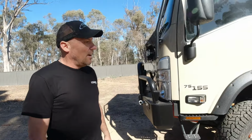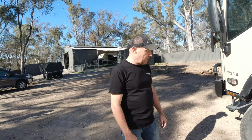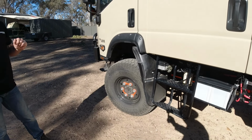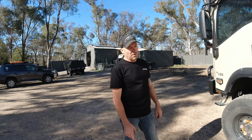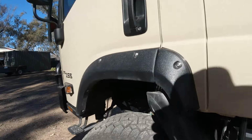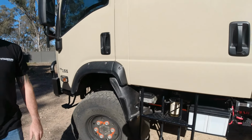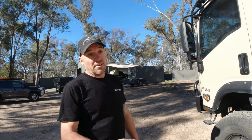And your tyres? We're running 37-inch tyres. These come with duals at the back, but AAV convert them to a super single, where the rear comes out to about a standard 31-inch. So they put the bigger tyres on, and suspension-wise we've gone to Brad Zacker suspension, which is King's off-road, because these trucks have a pretty harsh ride. That really smooths them out. You'd have a pretty big compressor for airing up and airing down. Yeah, we'll get to that in a second.